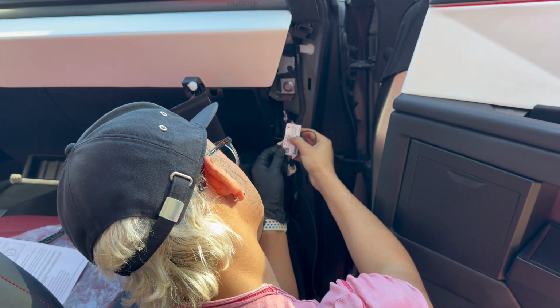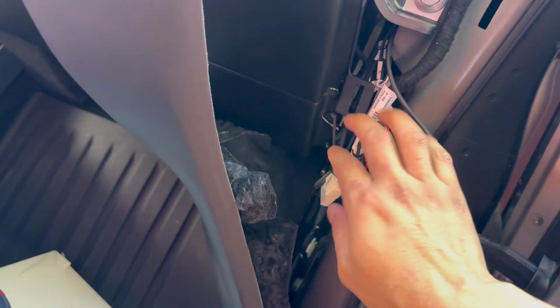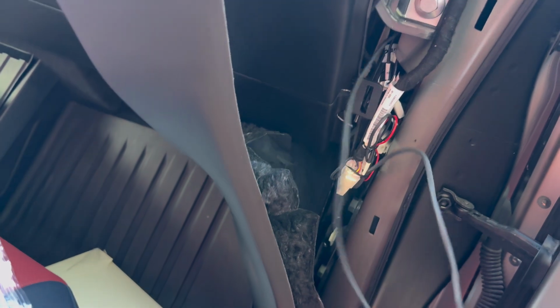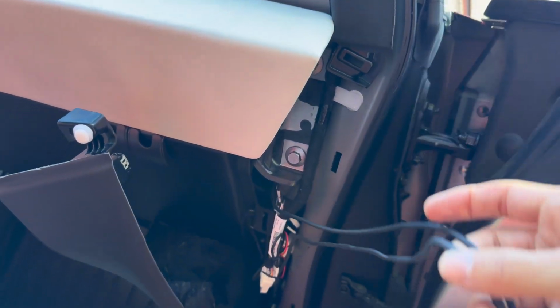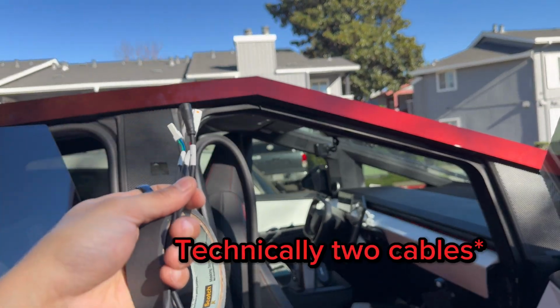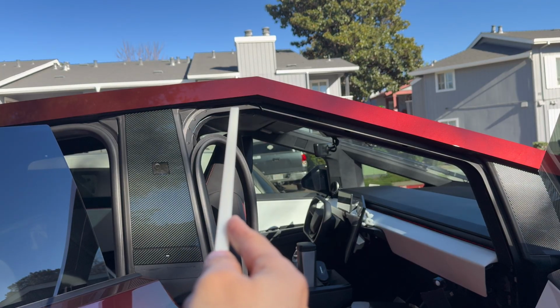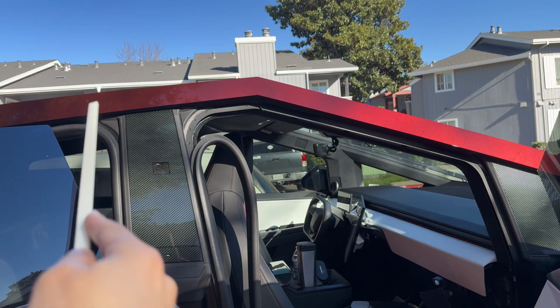It's called the A-pillar trim ATR. So I'm going to do some zip tying, just keep things a little nice and tidy, and then we'll move on to the next step. All right, here's my little zip tie job. Got everything neatly organized. Now we've got these two cables, which eventually we're going to run up and hide in this trim. Before we do so, we need to run these three cables through the pillar area in the ceiling and go back through the headliner into the rear.